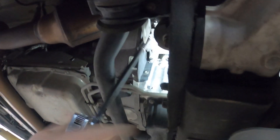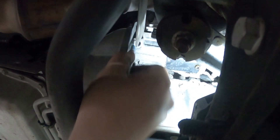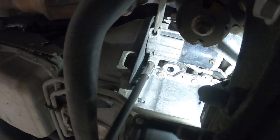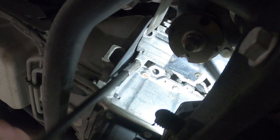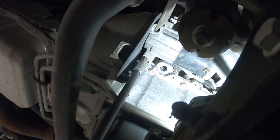He's getting all the bolts out. There's the first starter bolt. Go ahead and push that shield up — also if you take that bolt out it'll give you a straighter shot on the inside bolt, because with that 10 millimeter headed bolt there it kind of gets in the way. You'll get a straight shot on the inside bolt.